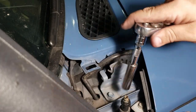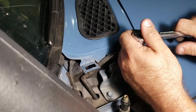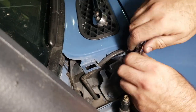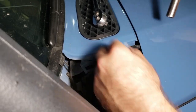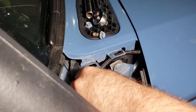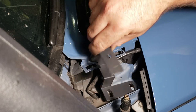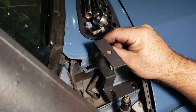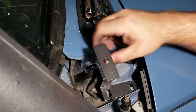You'll need a 12 millimeter wrench to take these two bolts off. Like I said before, it's a lot easier once you take those hood shocks off — no more pressure on the bolts. Make sure you put this hose out of the way; that is a drain hose. So the bracket will sit right here, and just like on the other side, it doesn't quite fit. We'll need some spacers.